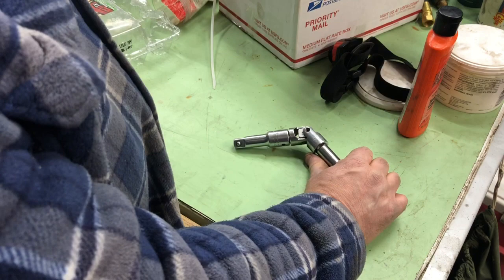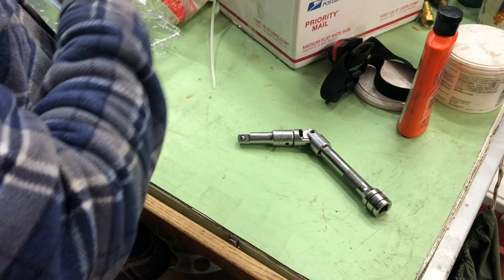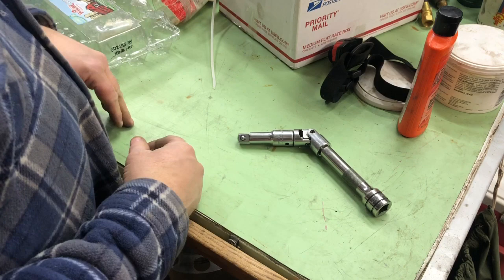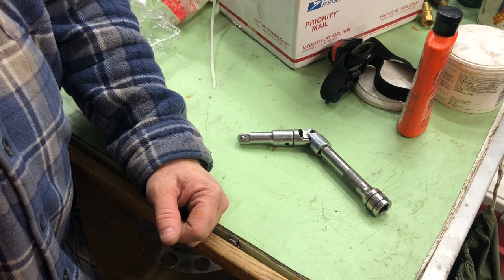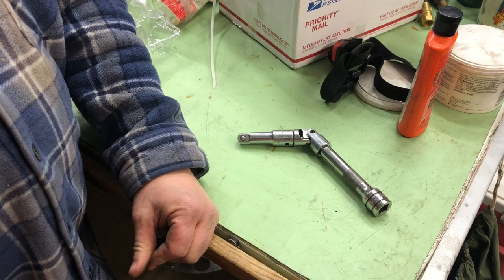But this 90 degree turn on this shaft up into the steering wheel meant that the steering wheel, through the miter box underneath the driver's feet, that's a 2-to-1 ratio, was completely 180 degrees off, so we pulled the steering wheel off and put it back in place. But now it's got more sensitivity going down the road. When you're on center and you're trying to track ruts and stuff in the road, it's a lot better. So yeah, less leverage.